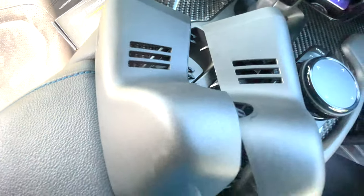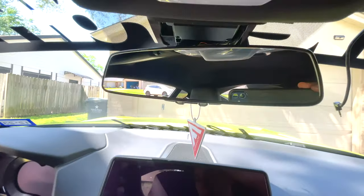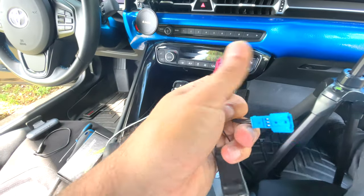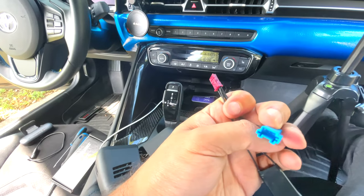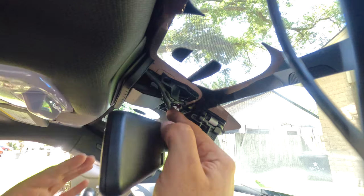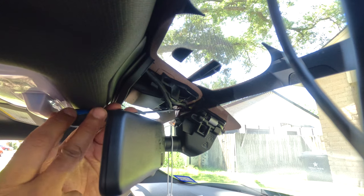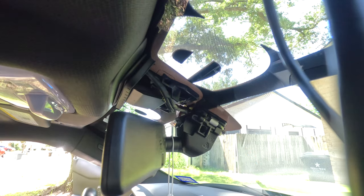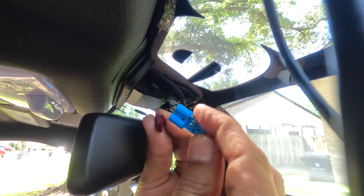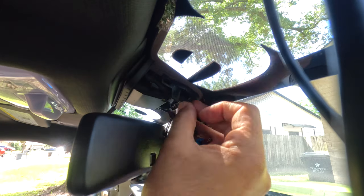Okay, so that's I think the hardest part. The other one now is to connect the wire. This adapter — the red one — we're gonna put it in there, and the other one, the OEM, we're gonna plug it back in. To disconnect the wire, be very gentle. I'm going to use a screwdriver to remove the clip from the bottom, but be very careful not to break the connection because it's made of plastic. After you disconnect it, you can connect it to the other connection on the blue one, and then the red one you can connect back to the original connection.